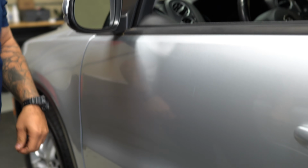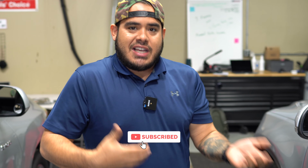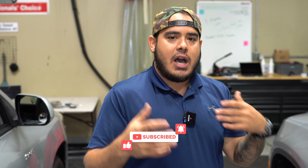But the glue, what that helps with is less pushing on the back end. So if I can get some good metal movement and bring something the size of a baseball, softball, grapefruit, and bring it down to something manageable, golf ball, tennis ball, something like that, it's gonna be less pushes for me, less fatigue on my arm as a tech. So the glue helps with bringing and shrinking that metal down to something manageable.